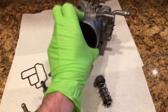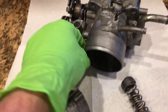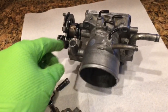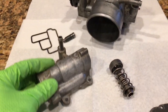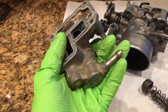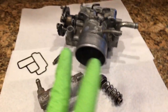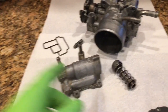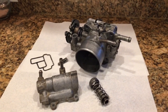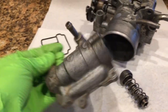If you're trying to understand how this works, you can really ignore all the upper side. If the idle screw is having no impact, it means the car is getting air through this bottom assembly. Once the car warms up, this should shut down that whole circuit and not let any air go through here. The only air should be through the idle adjustment screw, which you adjust up or down for idle. If you can't adjust your idle, or it's surging, chances are something's gone haywire with this pin rising up, or this little valve might be stuck or corroded. So there are only two ways air can get in: the one you have control over, and the one this valve has control over. Hopefully that sets you on the right path to diagnosing your idling problems with your 22RE and gives you a better understanding of how this throttle body functions cold versus hot, and why the coolant passages are such an important issue on the bottom of this throttle body.